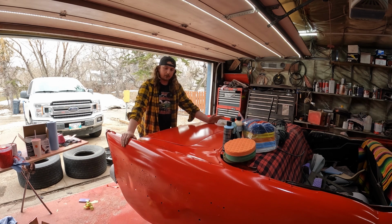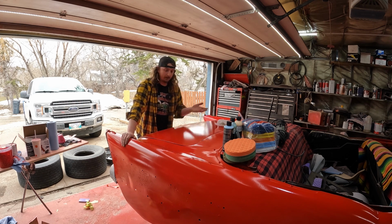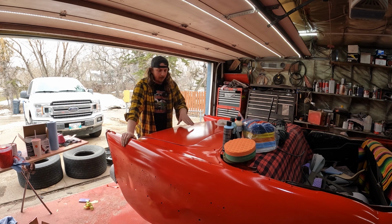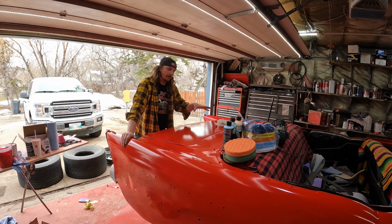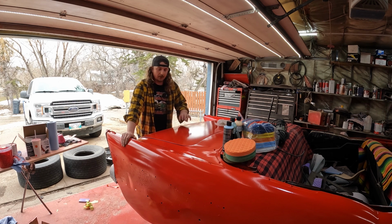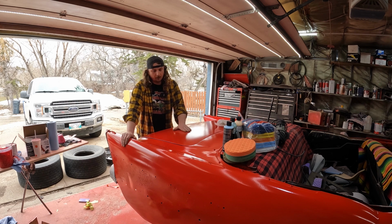I did watch a couple of YouTube videos, so I'm basically an expert on this. Never done it before. Never had a painted car I really cared about. So we're going to try that. Start at 1500. If we have to go down to like a 1000 or something like that, which would be a rougher sandpaper, it'll just take more material a lot faster.